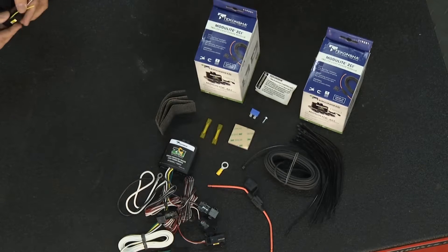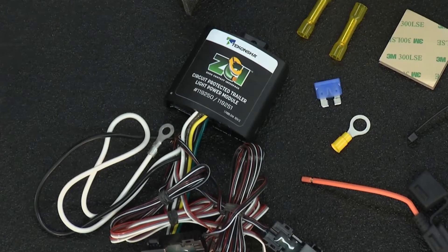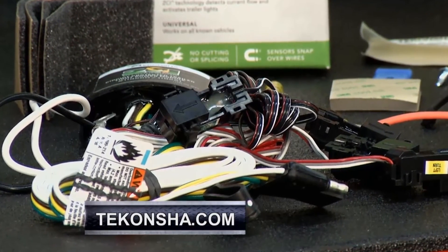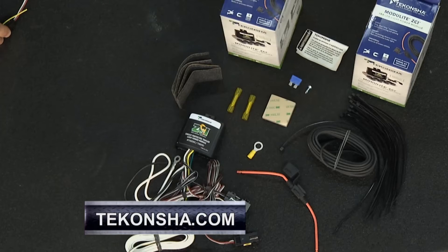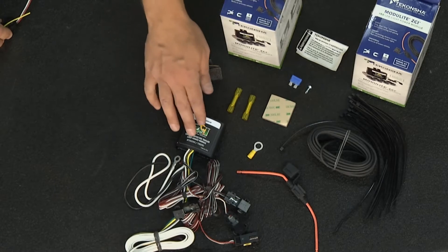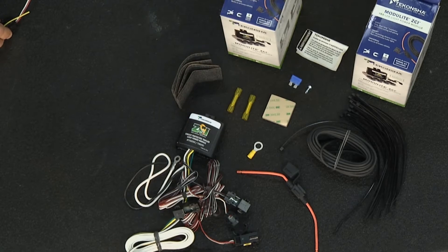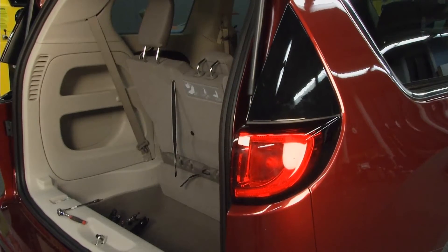There is a little bit of a challenge at the beginning during installation — you do need to figure out what type of vehicle system you have, and if you follow the instructions you just hook up the sensors accordingly and it'll do the rest. There's a computer chip inside the module that decodes your vehicle system. So we're not even tapping into the system — it's actually sending the signals to turn the turn signals on and off, the brake lights, and everything else.